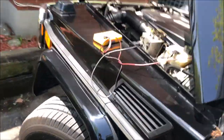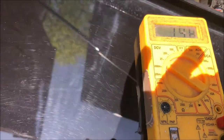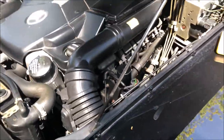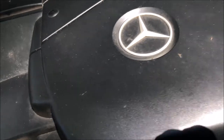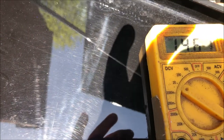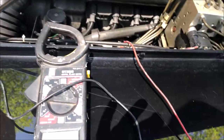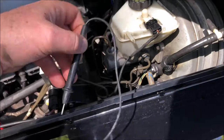With the engine off, the alternator is not putting out juice, so now we can see what the battery is sitting at. The reading shows 14.6 — that is not good, that is too high. There's no way it's 14.6; my battery would be exploding. I believe that little yellow electrical tester has been in my trunk too long because it was reading 14 volts with the engine off too. I've got another electrical tester and we're going to try that — engine off first, then engine on again.